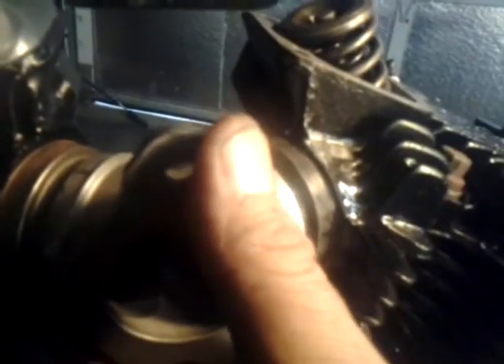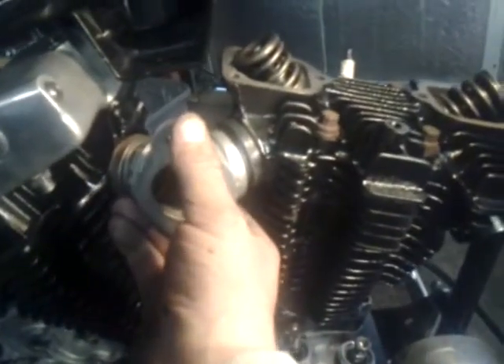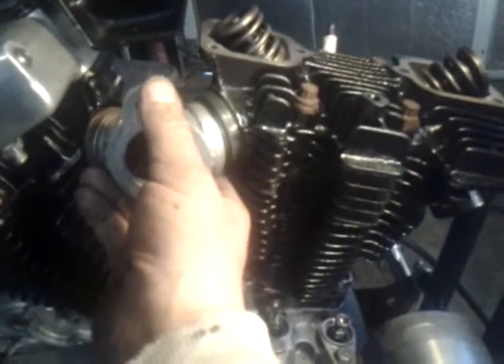Pull that around and put her in there again, take a look at her. Put that in there, and when you get it how you want it with no gaps — well, you're going to have a gap, but not uneven gaps, because you want it nice and even. That way your o-rings will go right in there; the o-rings go in their spaces right there, as you can see, and then your clamp goes over top of that. I'm pretty satisfied with that. I think we're going to torque the head bolts down per the manual — always use the manual.